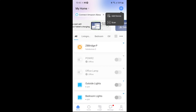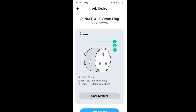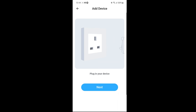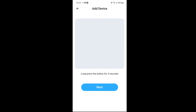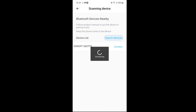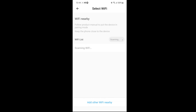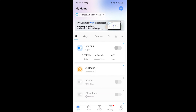Let's get it added into the eWeLink app. I'm just going to add a device and scan the top of the plug — and straight in, no messing about. It's telling me to add the device and plug it in, which I've done already, then hold the button on the side for five seconds to put it into pairing mode. The Wi-Fi LED indicator is flashing blue on the top, and it's found it straight away. I've chosen to connect to the device and connected to my router with my Wi-Fi password, and it's been discovered straight away. I click done, and there it is popped up on the top of the app.